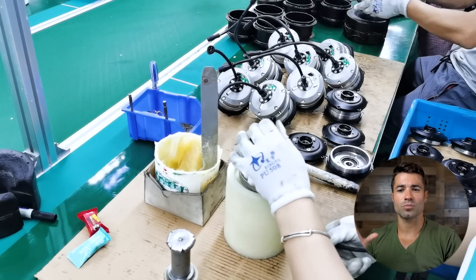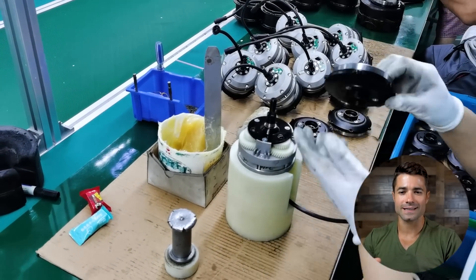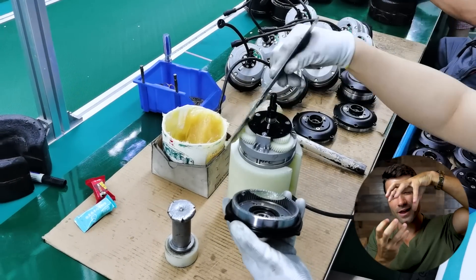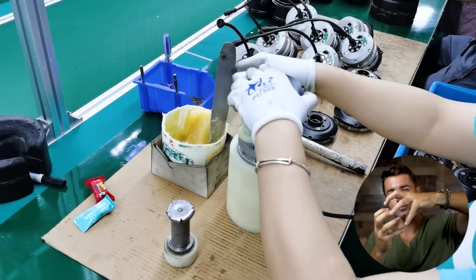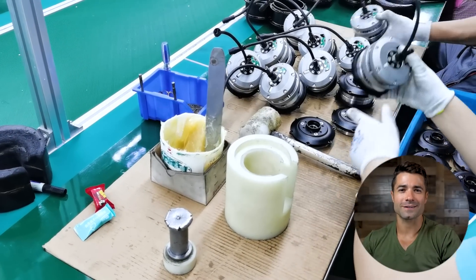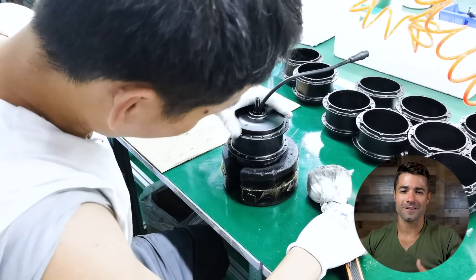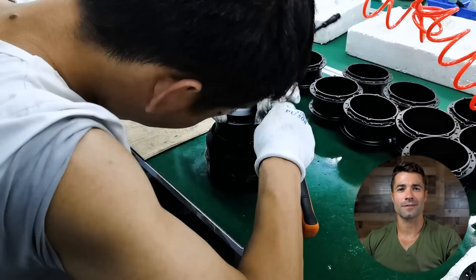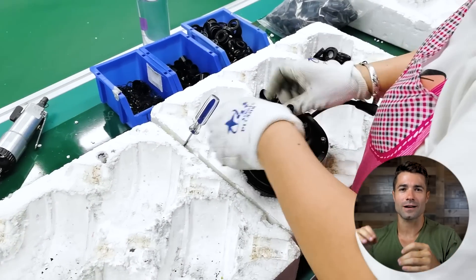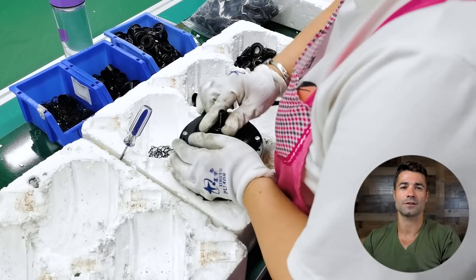Next is a big piece — that black component has bearings in it and you'll see teeth on the inside. Grease is applied, and that sits just outside the top level of planetary gears, with the gears spinning inside it to make the outer housing rotate with the bicycle wheel. The other side of the outer motor housing is then installed and tapped in to make sure everything lines up. Finally, weatherproofing gaskets are installed on either side of the axle to reduce the chance of moisture, dust, or dirt getting inside the motor.